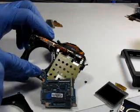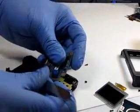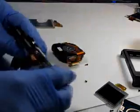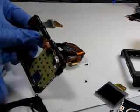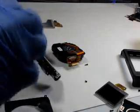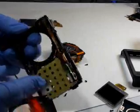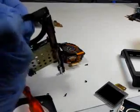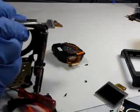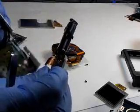To remove the board, you need to remove this clamp here. Take some tweezers and you can pop the clamp out like that and remove it. If you're replacing the flash power unit, you need to remove this screw here. The next step is to pry off your speaker — stick tweezers or some pliers underneath here and just pry that off — then you can remove your flash power unit.